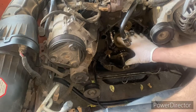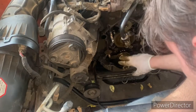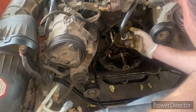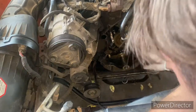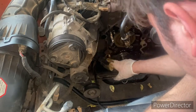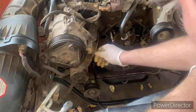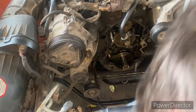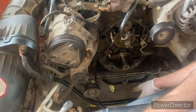At this point we have got our timing gear and chain off. I don't see any signs of extreme wear anywhere in here — all of our gears, all of our teeth and everything look good. I'm not concerned with much of anything I'm seeing here. What I'm going to do now is go buy some brake cleaner and some razor blades, clean all these surfaces off and also clean the mating surface as well. After that I will spray this all down, get it all cleaned up, and start reinstalling everything.